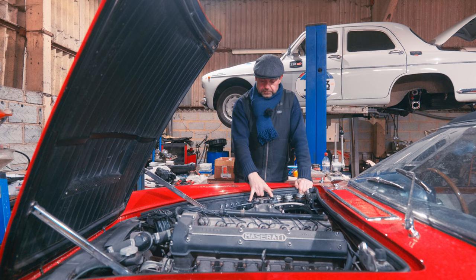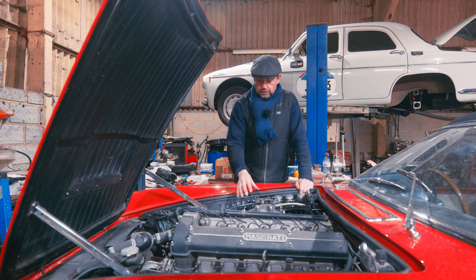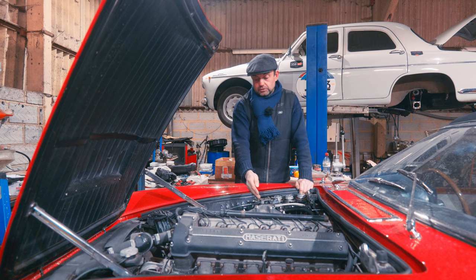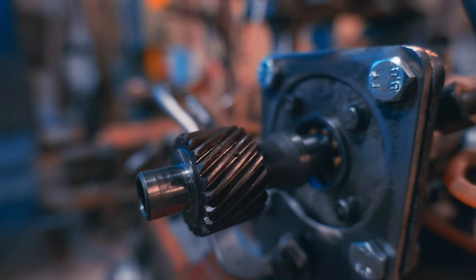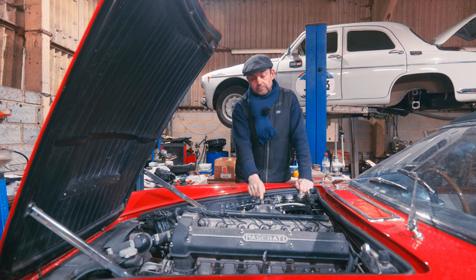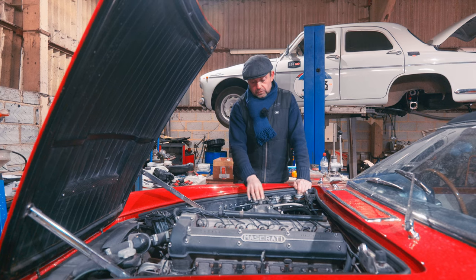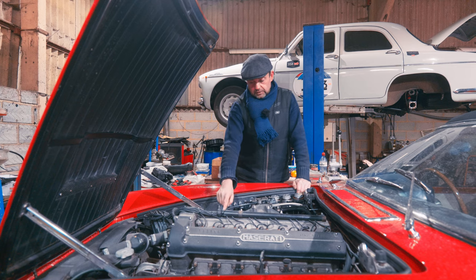So this is the top bit, which is the vacuum control unit. Via manifold vacuum, as we said, through here, and works out what's going on when, controls the amount of metered fuel that will arrive. It won't control when it arrives, because as we said, that's gear driven off of the camshaft and cannot alter. It's only the specific amount. So it's effectively your mixture, depending on how much airflow you've got through your manifold and depression and so on. This will control how much metered fuel will come through these pipes